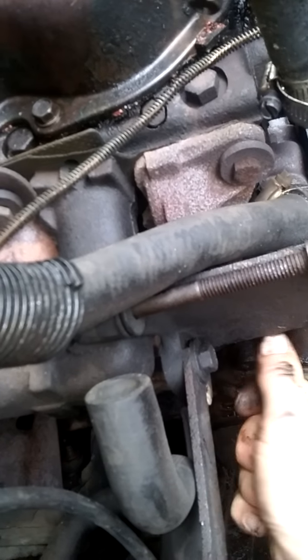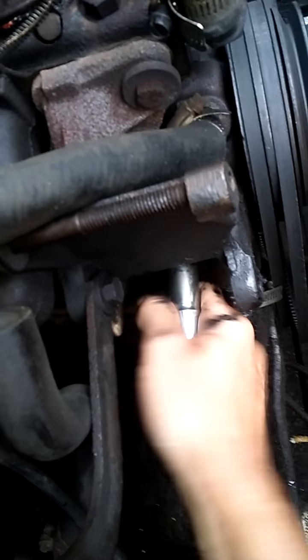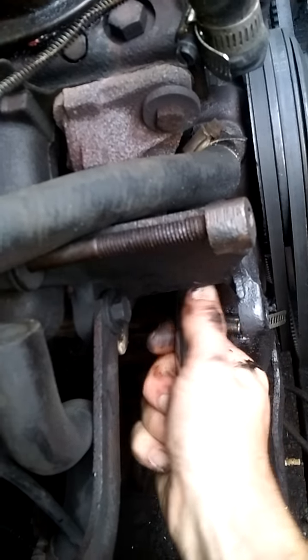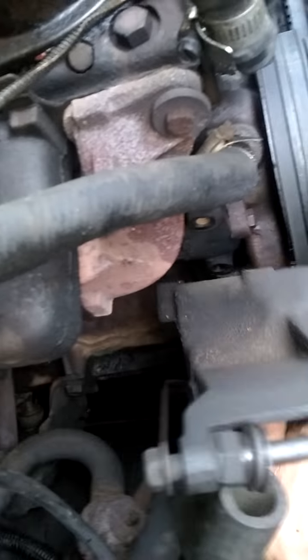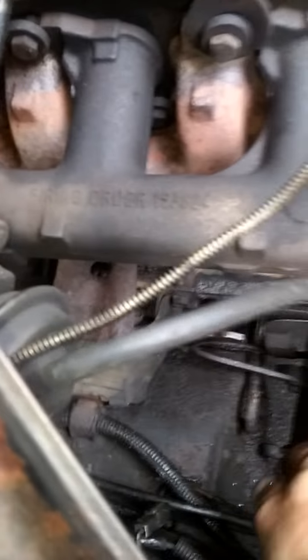This bracket here being in the way — it's in the way, not doing nothing. I'm also trying to come up with a lift point because I will have to lasso this motor and lift it about a foot or so. I need to do the oil pump and bearings on this — it didn't completely fail but I'm getting scared of it. And here's a vacuum line that will no longer be needed — I got to cap that off somewhere.